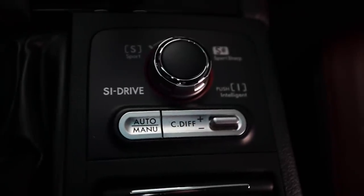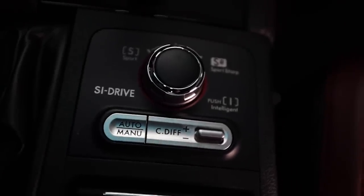The DCCD essentially allows you, the controller of the car, to set specific parameters to change where the torque goes depending on the driving conditions. With the DCCD, you have two settings: auto and manual. The manual setting gives you a lot more free range to adjust that torque however you want. I do want to make one thing clear — this is not a power split. It is not taking your horsepower and dividing it 41% and 59%. Playing with the DCCD really increases the handling capabilities of the car on different road surfaces.